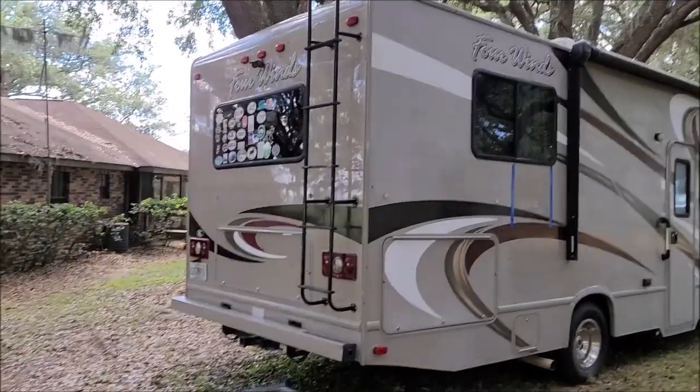All right guys, I've been working on this thing for four hours. Today is the first day, and it was about trying to figure out what the path of least resistance with this thing was. I definitely figured it out, and it all comes down to removing all that glue that the wrap company put on before I polish. I originally started trying to just compound through it, and while that's pretty effective, it was taking me like four times to get through it all to get a shiny patch. Isopropyl alcohol is working awesome to quickly remove this glue — whatever glue it is that wrap people use.